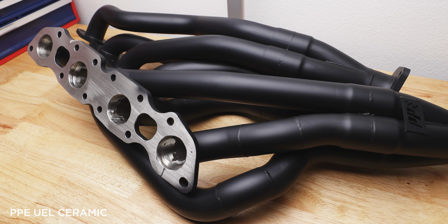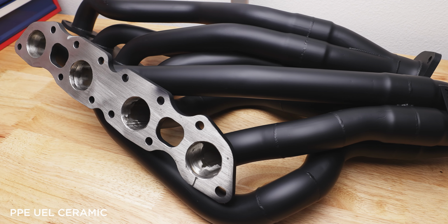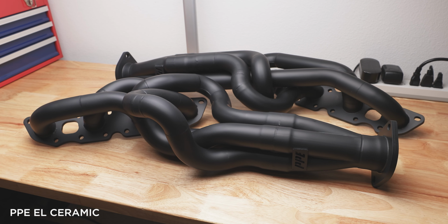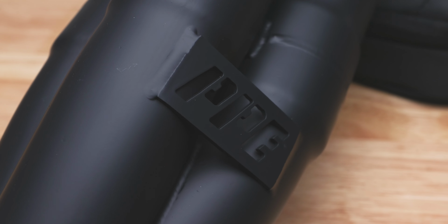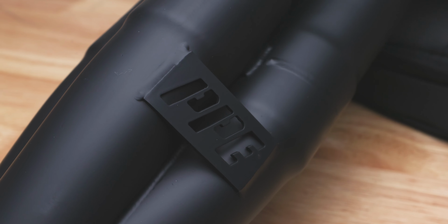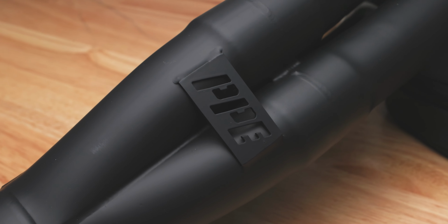So the real biggest difference between them is the sound. An unequal length produces a sound that's reminiscent of a traditional American muscle car. Think of American V8. Equal length and Nova-style equal length manifolds produce a more raspy, exotic tone. So if your perspective is to get the absolute maximum horsepower per dollar, then unequal length is the best choice. If you are looking for something more exotic sounding and you're more driver experience oriented, then equal length would be the one for you.